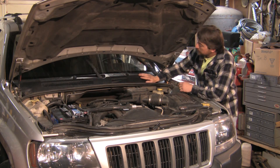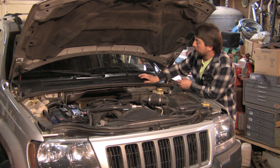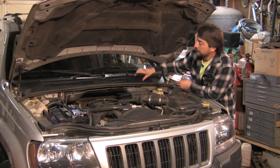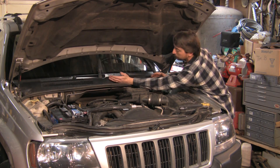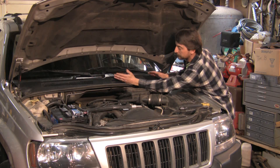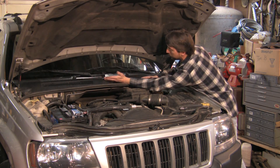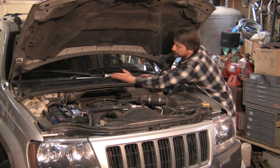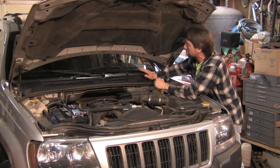Now how this process works is you'll have a wiper motor in here driving this transmission that we talked about. As this wiper motor is going around in a complete circle, it's hooked to a rod that's going to move. And this transmission in here is going to move in two different ways, because you can't have them move on the same rod — you won't get them going in the same direction. But as this one comes around, it's going to move an action similar to this, and as it's turning, as you can see the action, it's going to move that arm — both of them in synchronization.